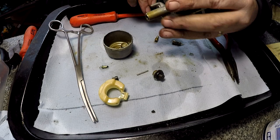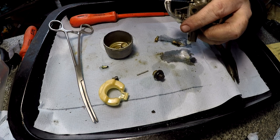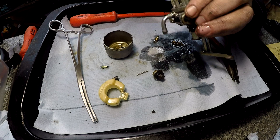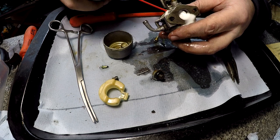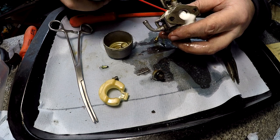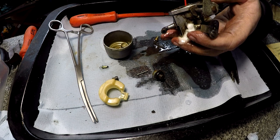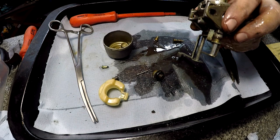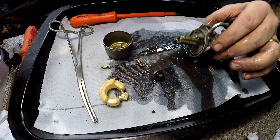The carburetor has now been stripped to where it needs to be. I'll use some WD-40 initially - this is the problem we had in this hole just here, which is now running. It'll be air compressed so that we can guarantee to get fuel through. Every single hole, every single orifice will have something blown through it just to guarantee maximum fuel delivery. That's the important one on there - so every single hole, give it a squirt and an air compress to make sure we're getting all the fuel orifices clean.